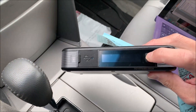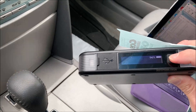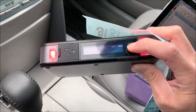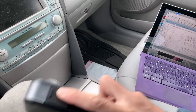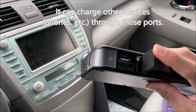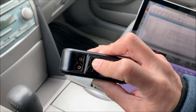Let me show some of the other things this power bank can do. If I hold the button down, there's a flashlight. Click it again and now it's blinking. Double click the button and it gives you two red lights — blinking lights. So this can serve as a kind of hazard light for your car. You can charge it through a small USB-C port, and it can also charge other devices through its USB ports. When you want to jump start, it has a connector that gives you battery clamps similar to what the charger has, which you connect to your battery.